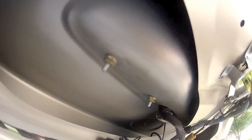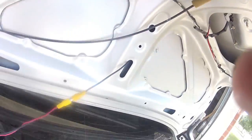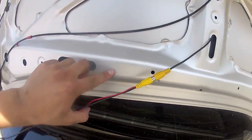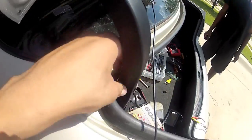Pretty much the inside of here, you'll see you've got pretty much all the extra cables there, except up to one of the reverse lights, and it's running through all wires in there to hold it in. For this unit to be removed, you've got three or four 10-millimeter screws right there. And pretty much just drill the hole — there was already a hole pre-drilled in the car itself to run the wires in. We've got this one which we'll run through the inside of the car, pretty much to the bottom of this, run it in here, try to run it through the bottom and the inside. All wires are already running through there, so we'll take that route.